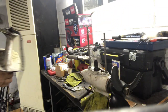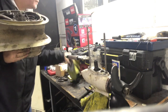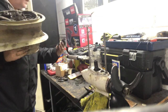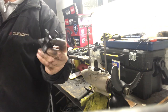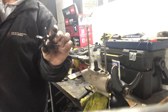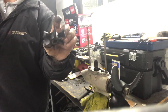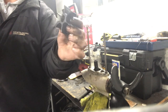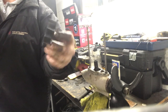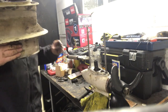It should come right off — yes, very good, all right. Sitting here, you'll notice that the impeller, the old impeller, has actually straightened out a bit, so it's not as worn out as I thought. It actually retook its straight shape. The elasticity isn't so bad, so I actually could probably reuse that. I did buy a new one, but I might decide to reuse it.